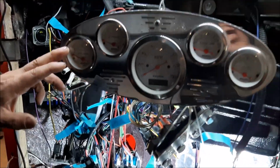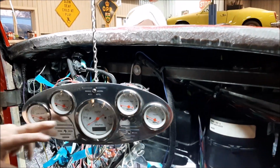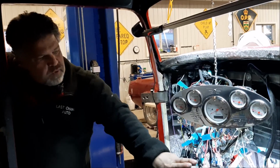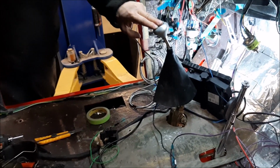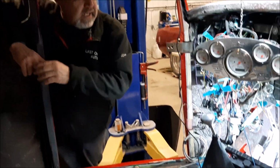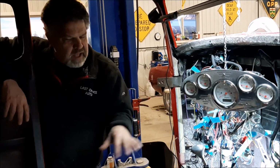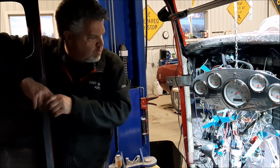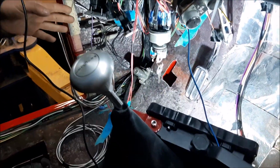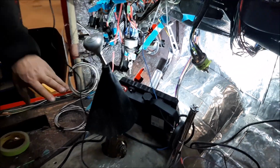And obviously we got these really nice Dolphin gauges. We've got the 4 gauges plus the speedo run by GPS, and it'll be quite accurate. Then there's brains for the transmission because you've got the upgraded 4L60E or 4L80E with overdrive, and there's sensors and solenoids, and none of that was hooked up, so we have all that to do shortly. We've got our high beam indicator. We've relocated the gas pedal and brake pedal in a more comfortable location. This is all low car stuff, so it's quite nice.